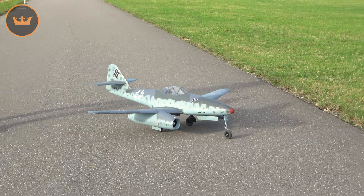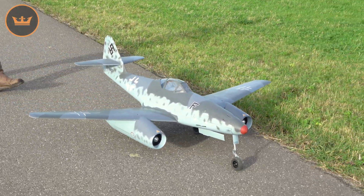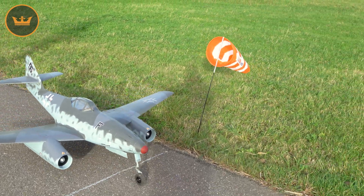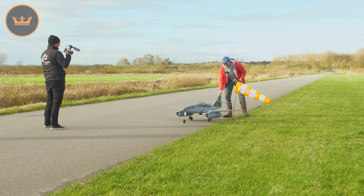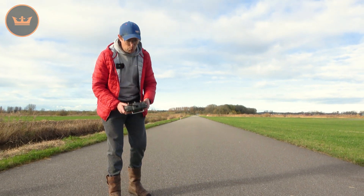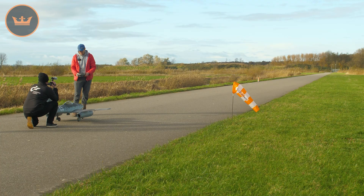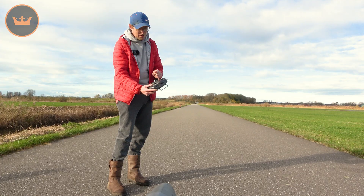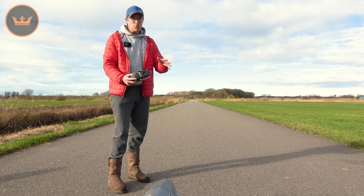That was the natural stop point without braking. Bringing it around, back to the start position again to do it with the RVS on the G2 engaged. It's on the blue line as it was before, and the setting on the RVS is linear — so as I flick the reverse switch, the more throttle I give, the more reverse thrust it gets. If you really want to brake in a hurry, you can just give it as much power as you dare.